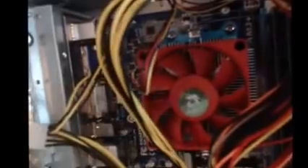Before you mount the motherboard, you want to put the processor in — that only goes in one certain way, you can't make a mistake. The processor is underneath this fan and this condenser. The condenser and fan came with what's called thermal paste, and you've got different kinds. The machine came with thermal paste already, but it never hurts to put just another little dab. The thermal paste helps draw the heat off the top of this processor, which that fan then draws out through the side panel through that little tunnel.